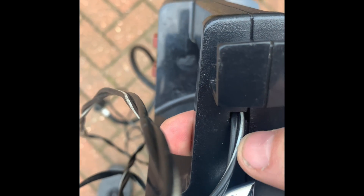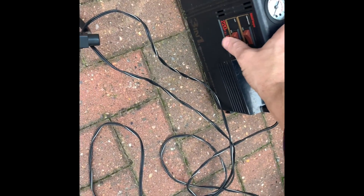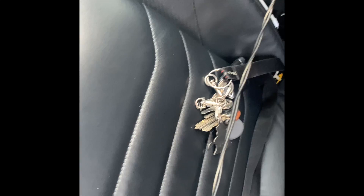It's the moment of truth — let's get into the car. The compressor has been repaired; you can see there's no damage to the wire here. We'll put that on the floor, find the 12-volt plug, plug that in and switch on. It's still not working — maybe this socket is switched live from the car. Yes, it is. One working compressor! My heart was dumping there for a moment, but this socket on this car is obviously switched live from the ignition.